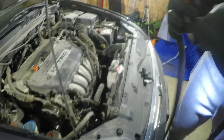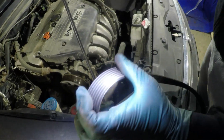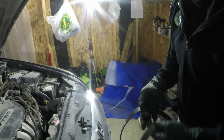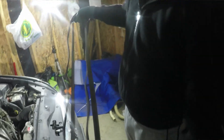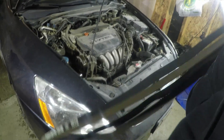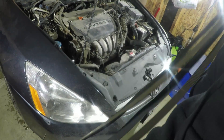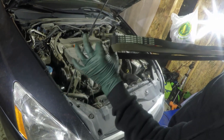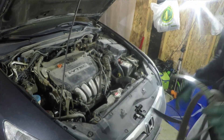Now, those are the cracks I was talking about — that is one indicator right there. Something wise to do is compare the old part with the new one to make sure they match. I'd expect the new one to be a bit shorter or tighter. Look — you can see how stretched the old belt is. They're both laid flat but you can clearly see the stretch, and we saw that the tensioner arrow was moved to the right side.